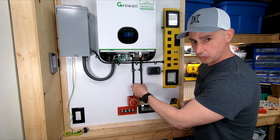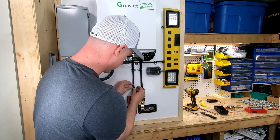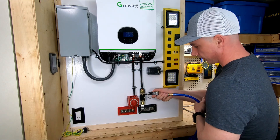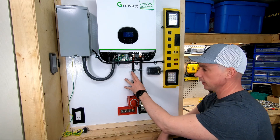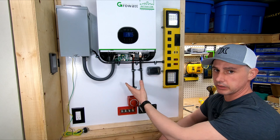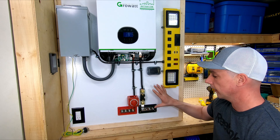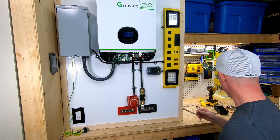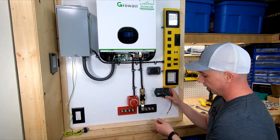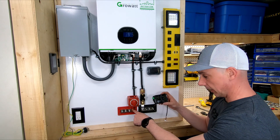I'm going to put one more clip here just because this is a longer run. I've got my positive and negative run here — I left a bit of slack on these wires too, just for expansion and contraction. Next let's hook up the shunt and then we'll hook up the battery and see if it works. This is the control unit for the shunt — that's going to plug in here and then I need to run an extra positive cable over to this bus bar to get it power.